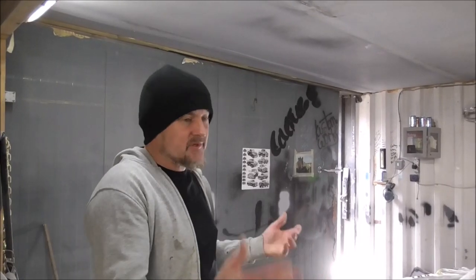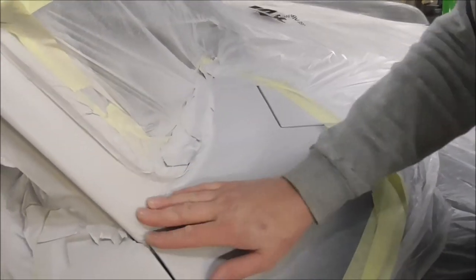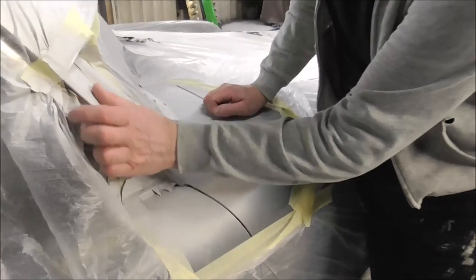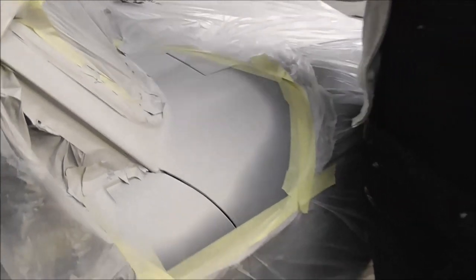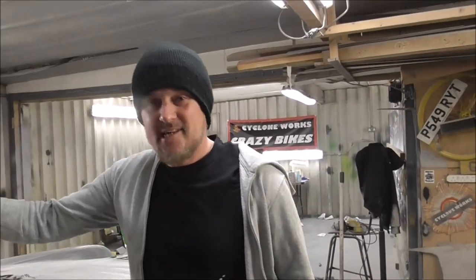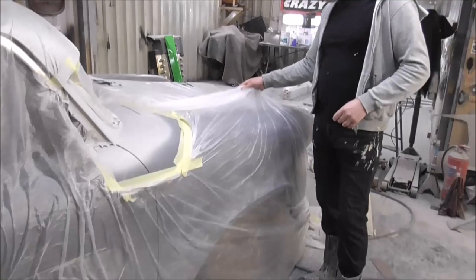As I was prepping, I came to a point where I had two little bits that I wanted to do extra work on. Just here we had some flaking paint but it turned out it was a little bit more serious, so quite a bit of body work has gone on there. I've also snow ploughed this part of the window pillar and got rid of the rain gutter - done this on both sides. And I did some work on the back too - I've had to put some extra high build primer on there.